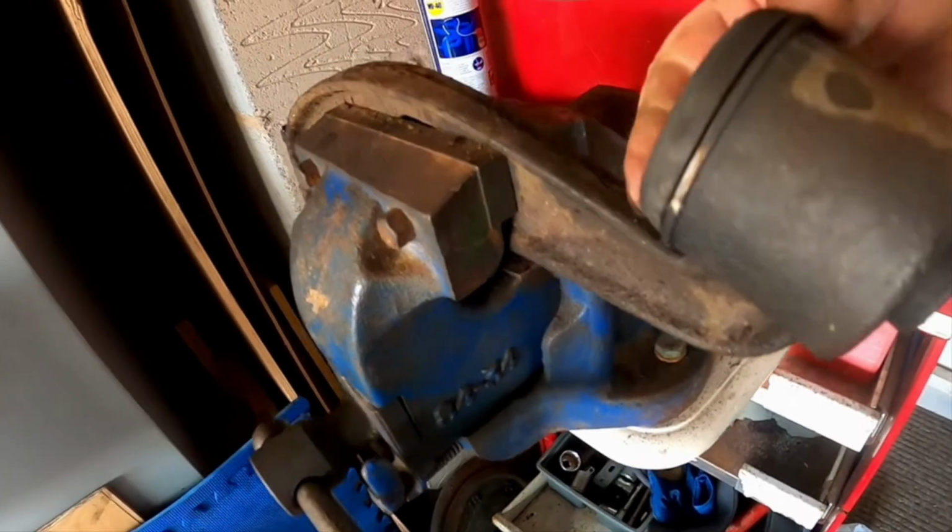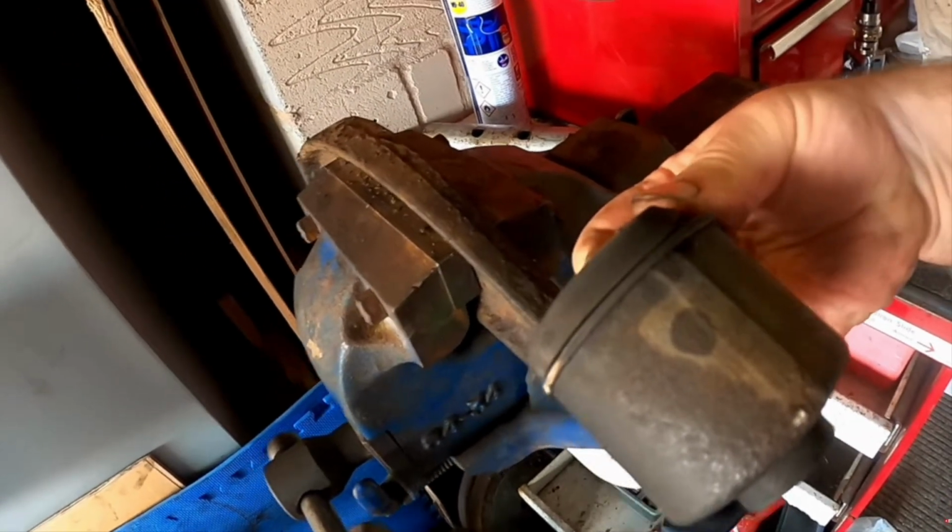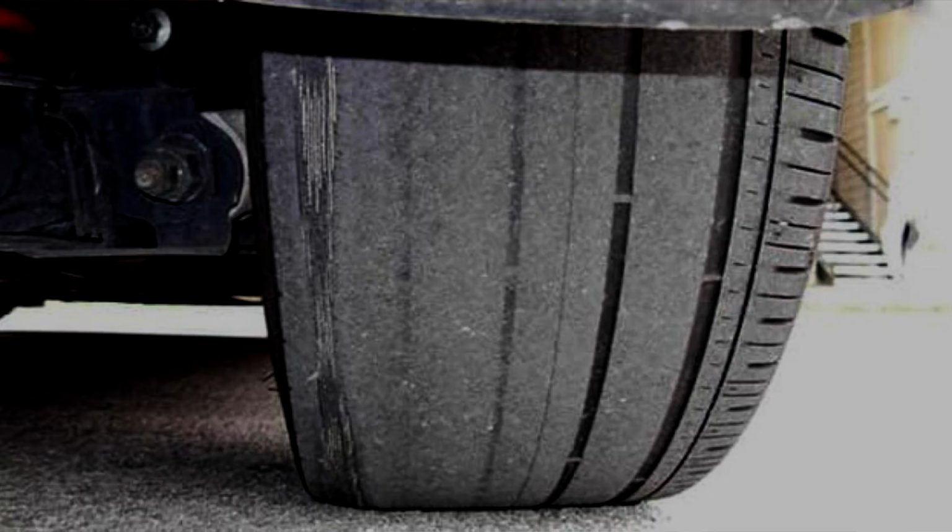Surface rust is common. The car has double wishbones throughout, which means that worn bushes will be common on high mileage cars, so anything over 100,000 Ks and definitely needed by 150,000 Ks. You can check while driving the car and aiming at a target and then turning while braking. Failing lower arm bushes will make the car feel imprecise, while worn front arm bushes can cause a wobble when braking. Check for uneven tyre wear as another indicator of those worn bushes.